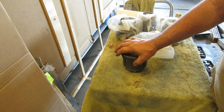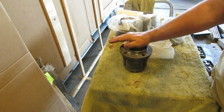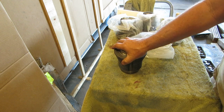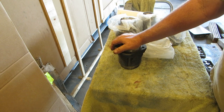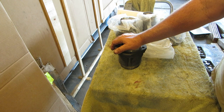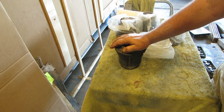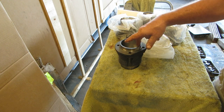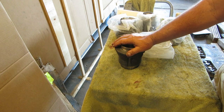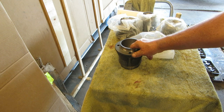well, people say you can do it, and people do it all the time. And you probably find people who have 1776 or 1835 engines with 100,000 miles on them. But likely not. Likely not. But what you have here in the Blue Beetle is a 1600 cc fuel injected engine with over 150,000 miles on it. It was fuel injected, so it didn't wash the oil off the cylinder walls like a carburetor would in a choke. So that's why it lasted so long.